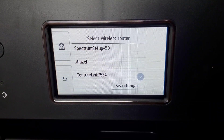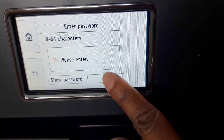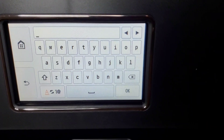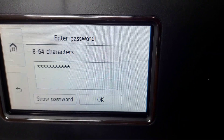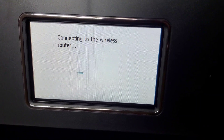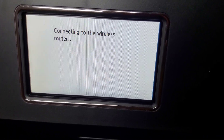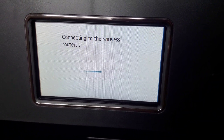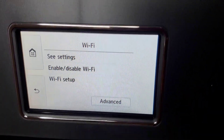Now I'm going to show you how to do the wireless Wi-Fi setup on the printer. Go to the home screen and press Settings, click Device Settings, then click LAN Settings. Click Wi-Fi, then Wi-Fi Setup, and hit Wireless Connect. It's going to search for your Wi-Fi, and once it finds it you'll be instructed to put in your password. It's going to tell you when it's connected to the router. Once connected, click OK and then the home button — that's it.